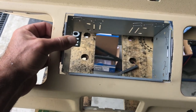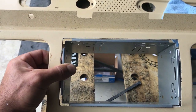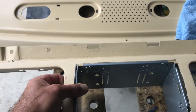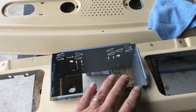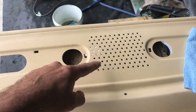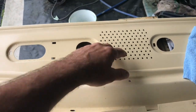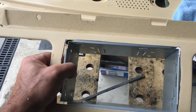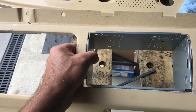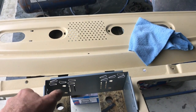I've cut this slightly bigger and I'm going to weld it in — tack it in. On the other one there were no real fixing points, so I used a hole or two and made a bracket from the top to one of the holes. It was okay, but with the dash out now I'm going to tack that in, seal it up, finish the dash off and paint it up to get it ready for installation.